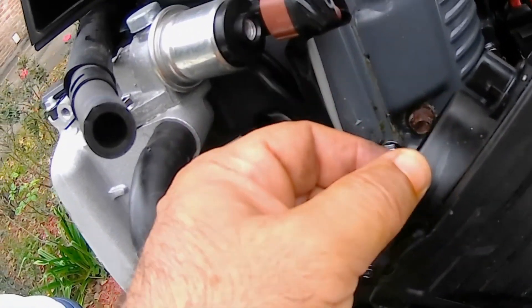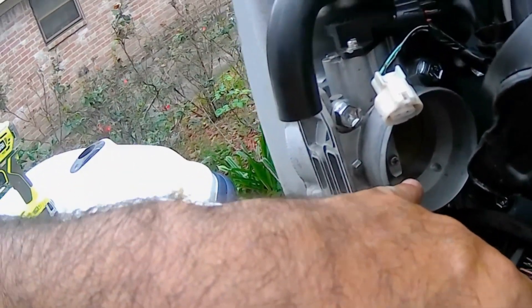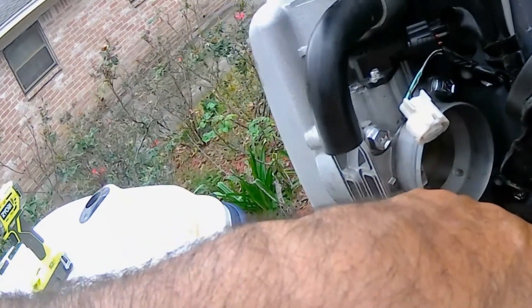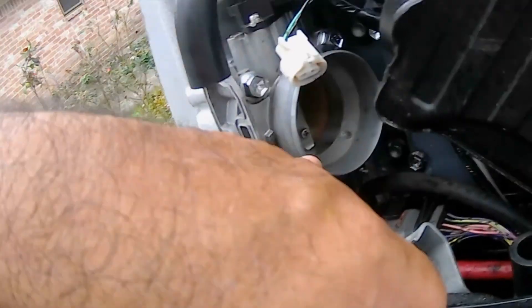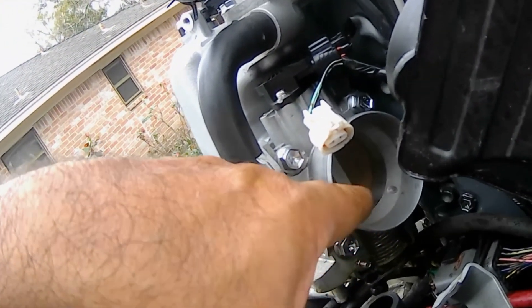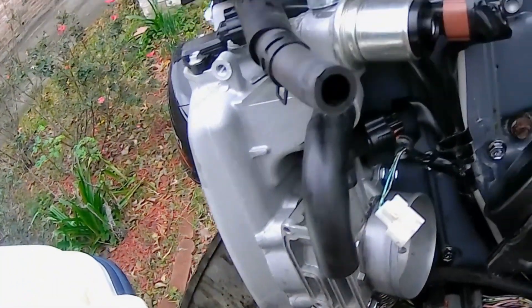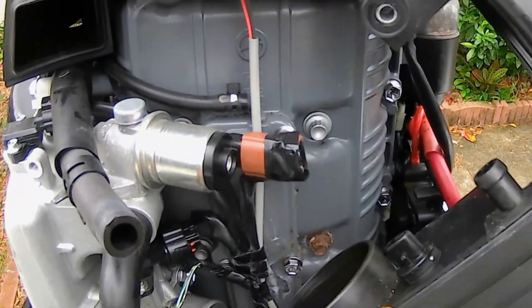While we're at it, we cleaned this area. I'm going to use a throttle body cleaner — I see a little bit of dust there. Clean the throttle body. Don't use carburetor or brake cleaner, and do not move that butterfly by hand — you may have to adjust it. Use your gas and get somebody to help you if you need to. We're going to clean that as well, and I think we're done.